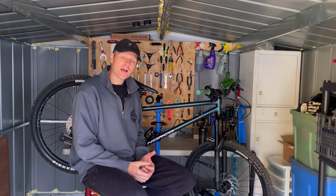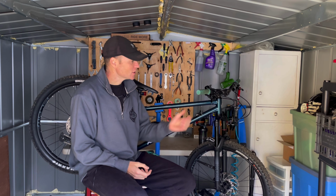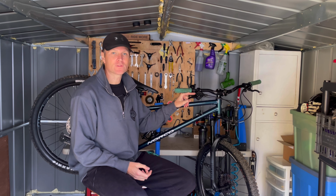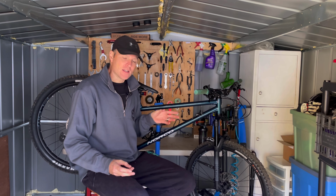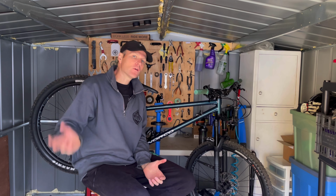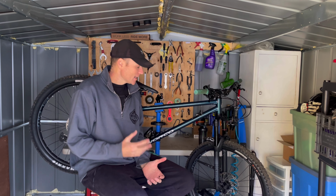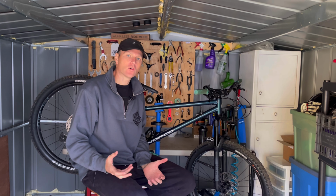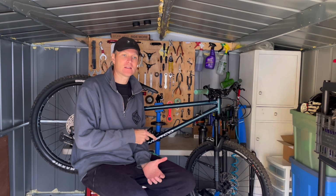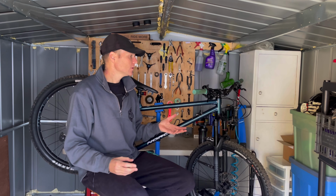The only reason why I would suggest going with a 520 is because you get a little bit of the servo wave action, and you get a little bit bigger of an adjustment bolt for your free stroke. That's it. You cannot go wrong with these brakes. If you're looking for a brake upgrade, and never mind going down the whole rabbit hole thing of should I get 2-piston or 4-piston, right now you'd be crazy not to go with 4-piston with these brakes specifically at that price. It's insane. They're bomb proof, they work, they're extremely reliable.